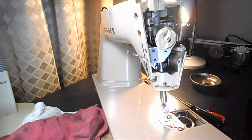So that's how to reassemble the presser bar system if you've removed it for cleaning or replacing a damaged part — and the sequence of how to set the correct height between the top of the needle plate and the bottom of the presser foot at five-sixteenths using five quarters. Thanks so much for tuning in, and check back with me when you have time to see if I've got some other good videos. Take care.